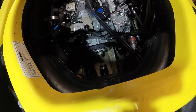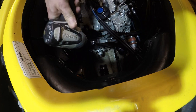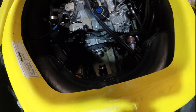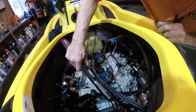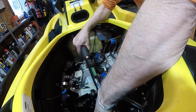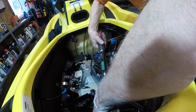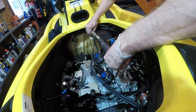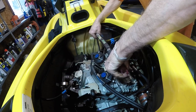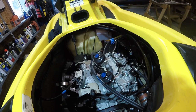I need to get a torque wrench. Torque that down. That's a reach. Just going 25, any more, it'll tear the bushings all to hell. Had that and had to replace the engine mount after installing. Your tendency is to want to really over tighten them, but the mounts can't take it. Okay, I'll pull the alignment bracket off the back.